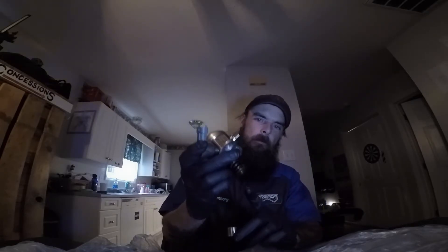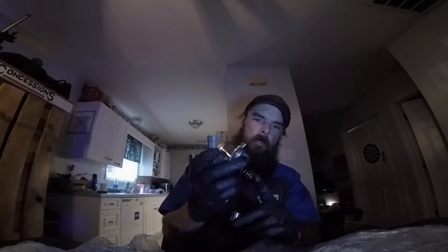She went 22,000 miles without an oil change, and it completely ate the bucket — it ate the bottom of the plunger. And this is a really, really tough spring; I can barely push it.